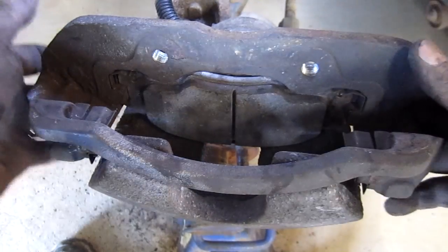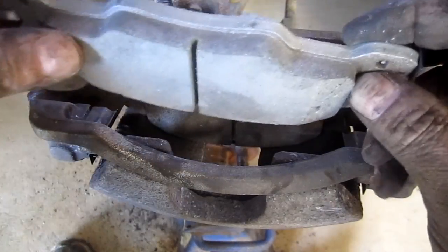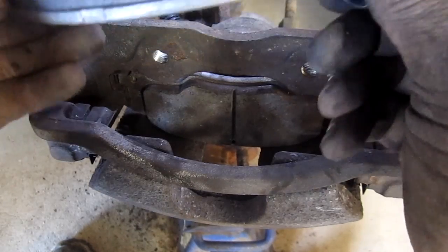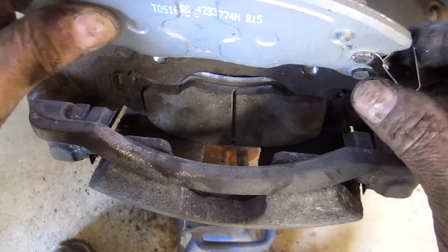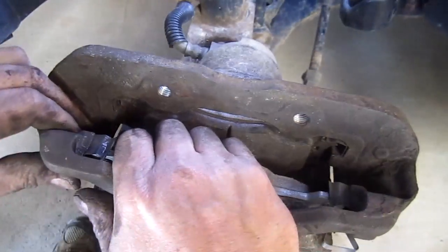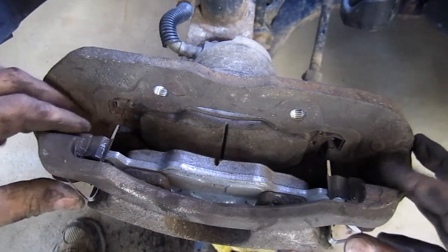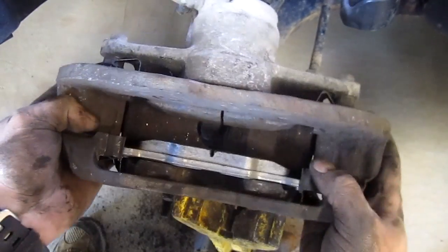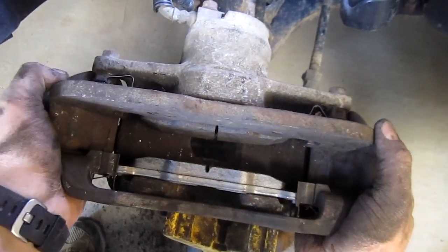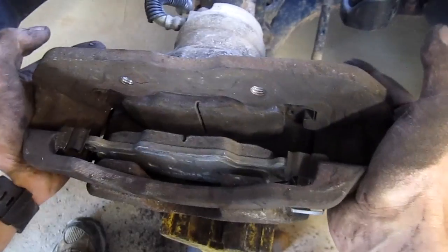The outer pad needs to be in the same position. Because of these spring tensioners, typically you'd remove the caliper pins themselves, but I'm just going to finagle them out of the way, get the pad in place, and bend them back. If you bend those spring tensioners, make sure you bend them back so they're making contact with the back of the caliper bracket. Then make sure your boots are good and the caliper bracket moves in and out smoothly.